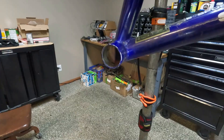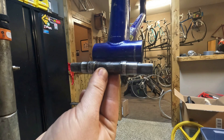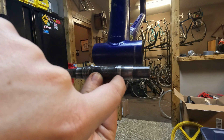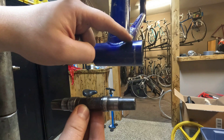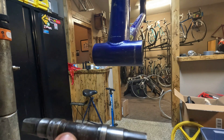Now the frame is prepped. You'll notice that this spindle is not the same on both sides — there's more spindle past the bridge that the bearing butts up to on one side. We're going to call that the drive side. There's a larger shoulder on the non-drive side, so less spindle sticks out past the bearing there. There's also more bottom bracket shell sticking out past the drive side than the left, and we need clearance for the chain rings on the drive side, which is why it's longer on that side. So we're going to prep the bearings and get this put in.